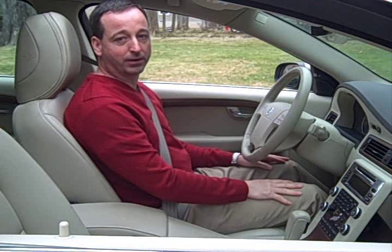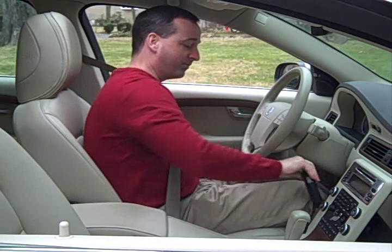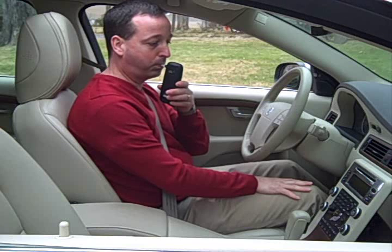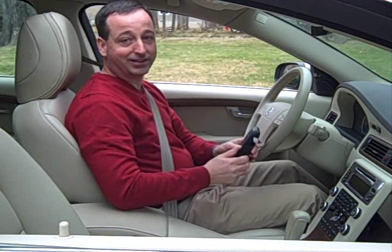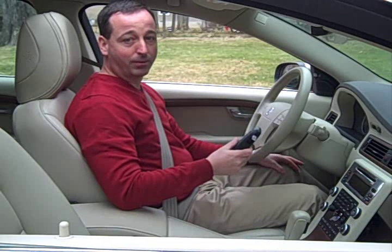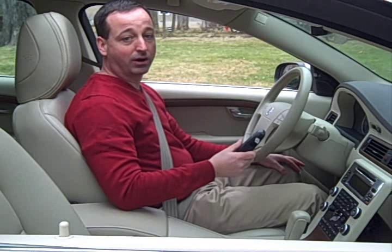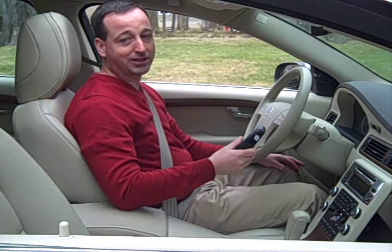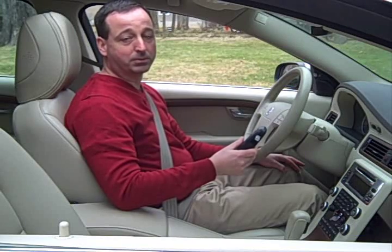Here's how it works. After the warm-up period, remove the handset from the cradle and blow into it for five seconds. You will hear a click. The LEDs on the handset will indicate the result. Based on the results, a radio signal is transmitted from the handset to the car's electronic start inhibitor to lock the car if failed, or to allow you to start if passed. The immediate test data is stored for 30 seconds. If during that time the car has not started, you will have to repeat the procedure.